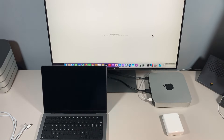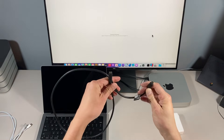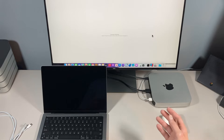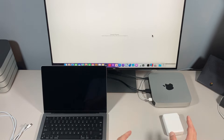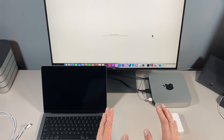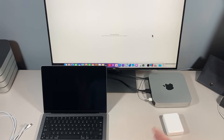At the very least you can use a USB 3.0 cable with USB-C ends, or a USB-C to USB-A cable if you have an older Mac. You can run the operating system on the host device all the way back to 10.15.6 and Apple Configurator 2 will work on that. So those are a couple of different cabling options. Now that we know the cabling situation, let's talk about getting the 14-inch into DFU mode.